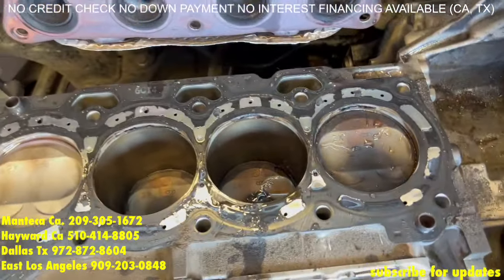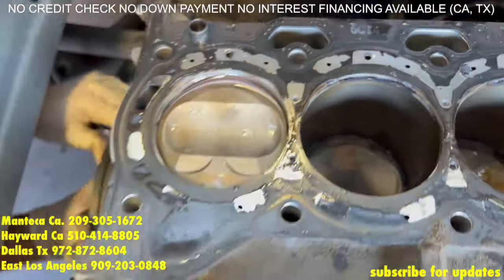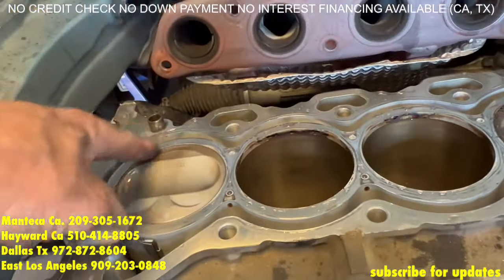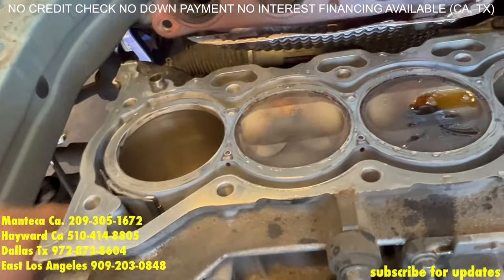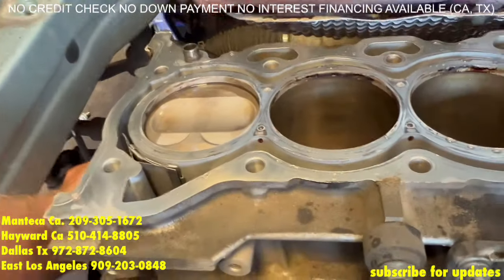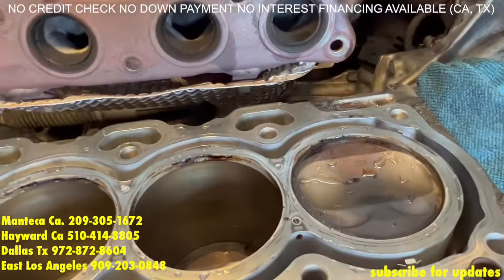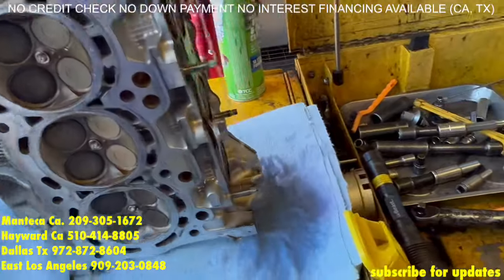Now as you can see where the failure is on this one — it is kind of obvious. The piston still has a little carbon build up on this one, but this one is a lot cleaner. You can see the head gasket failure right into the number one cylinder. Let's remove this gasket and we are going to check piston height. We are going to put the harmonic balancer back on and look and see — these are flush with the deck, these look good. By doing this, you are checking to see if the connecting rods had a bend from hydrolock. If for example this one was at top dead center but this one at the same time was a little lower, then you know you would have a bent connecting rod. But in this case they are both going to be the same height.